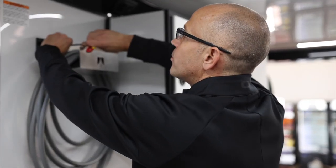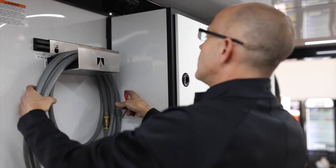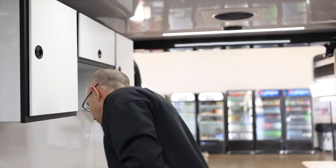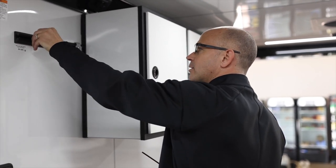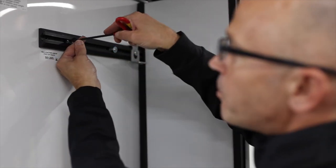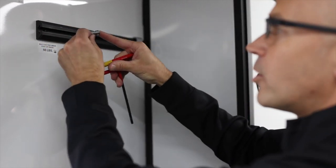To move the modular accessories in the ATC Lifetrack system, all you need is the 3/16th Allen wrench. Generally loosen it up a little bit — don't loosen it all the way to the point where the screws are coming out, just enough so that you can loosen it. Take your cord reel off, and then you can actually just lift the device up and out. We use a flange head screw. Take that all the way out. If you need to move these to a different place in the trailer, take the screw out, then take a screwdriver to push the top of the roll-in nut up at an angle, and you can get your fingers in there and remove it from the track.